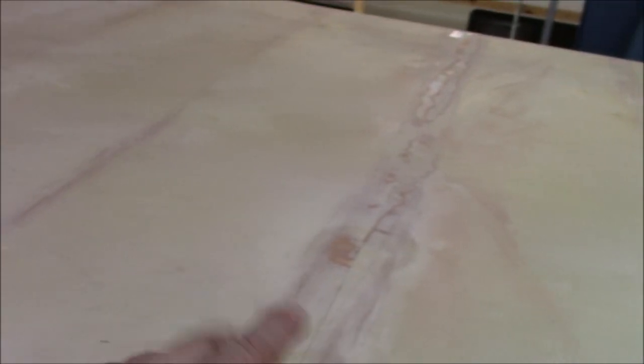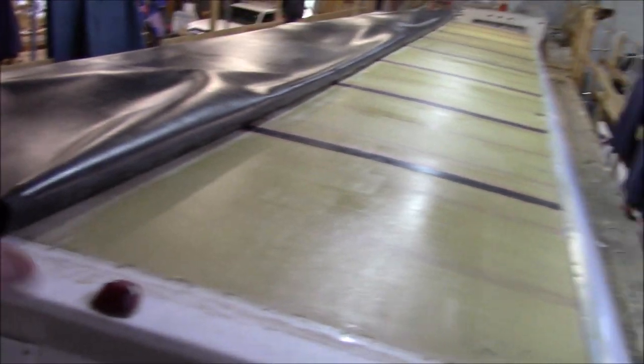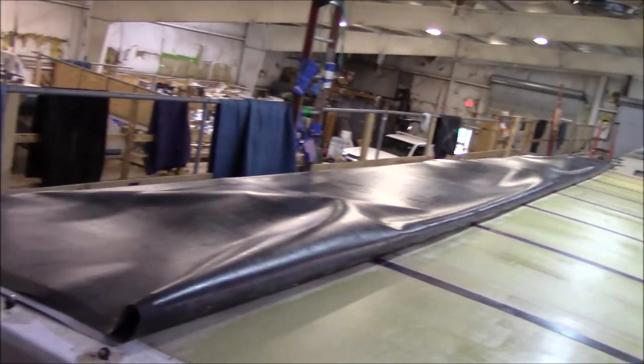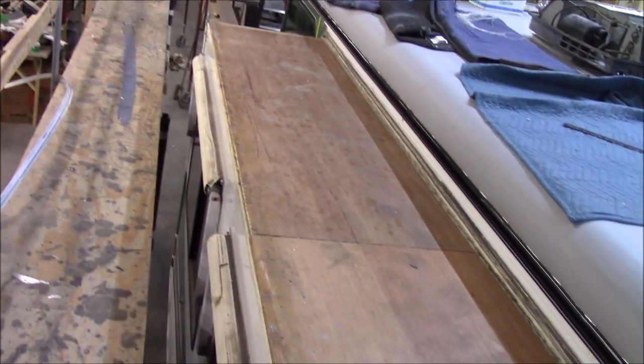We've got our new roof deck down. We're sanding down some edges that may be slightly higher than others — sometimes when you glue it with urethane foam adhesive it'll push one end up a little bit, so we're just knocking it back to get everything smooth. Then we'll put our seam strips across, protect the strips, and get the roofing membrane on. We've got one side — the passenger side — glued and ready to roll over, then we'll do the other side. The slide-out deck is good; we're replacing the rubber roof with a metal pan on it, all prepped and ready to go.